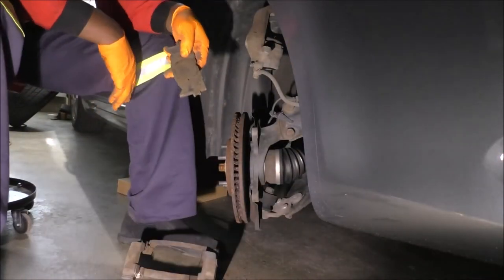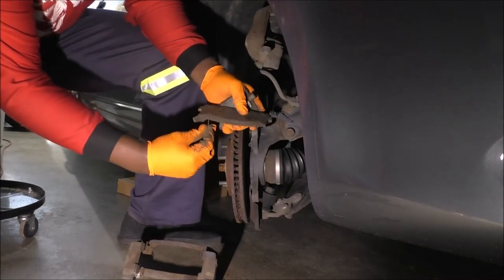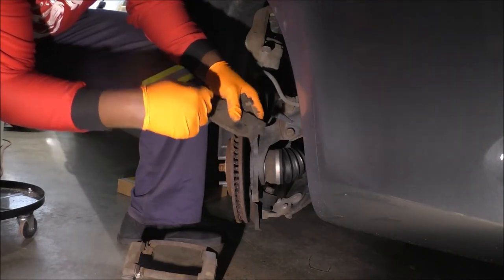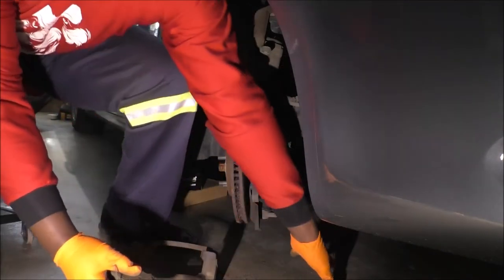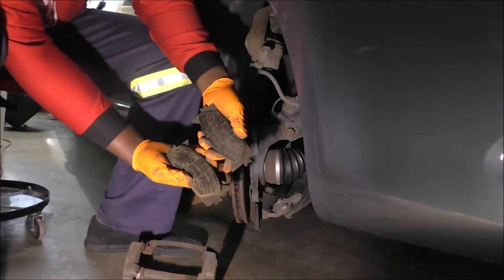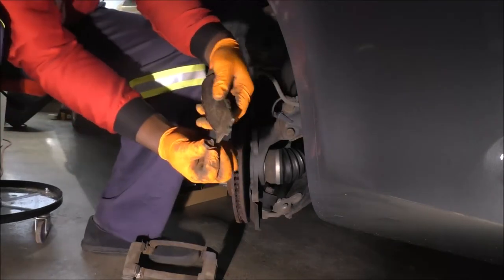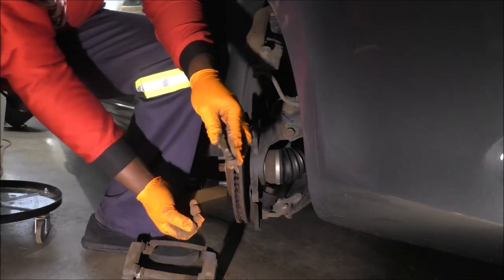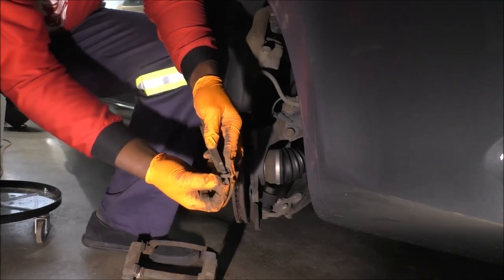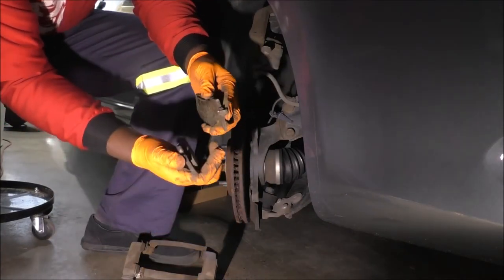Okay. So you do have the piston side, which is on the inside. You have this other side on the outside. Get my clips. Put them right here because it can be easy to forget. Look at the pads. Well, this one here had a clip that broke off. But this right here is called the wear indicator. It's supposed to protrude far enough that when this wear material thins out enough, you'll have this metal tab scratching your rotor, and that makes a horrible, horrible screeching noise. Seems like it broke off on the other side as well.